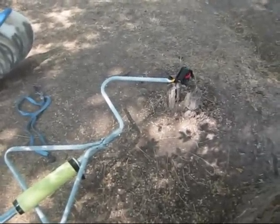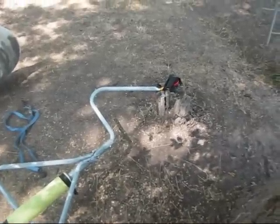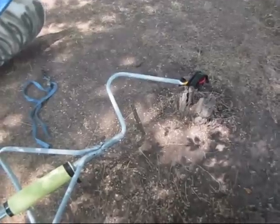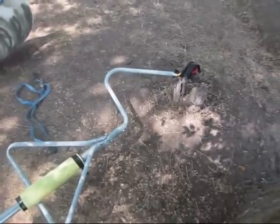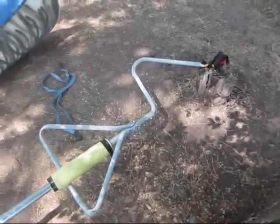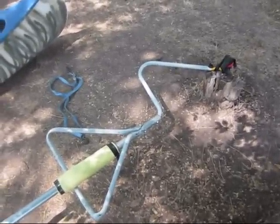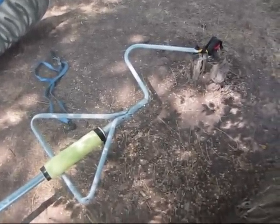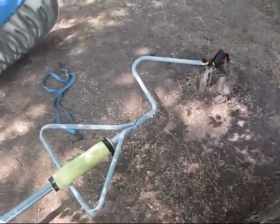That's the hitch. The trailer has a very good hitch on them that you can attach to any bicycle. You don't need two pieces, it's just one piece. I actually took the hitch assembly off of the trailer and there was a metal piece I had to grind the welds off of so I could slide it inside of the conduit.